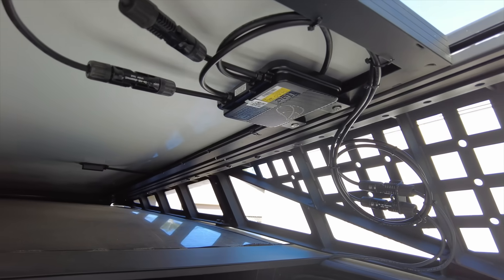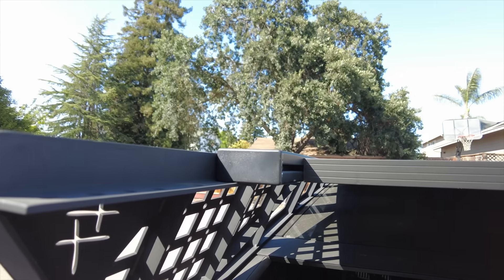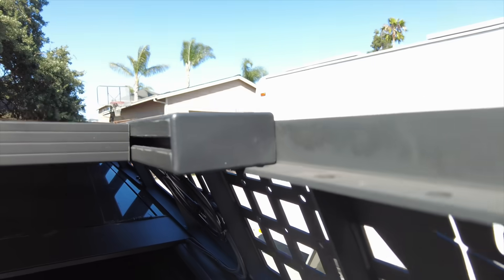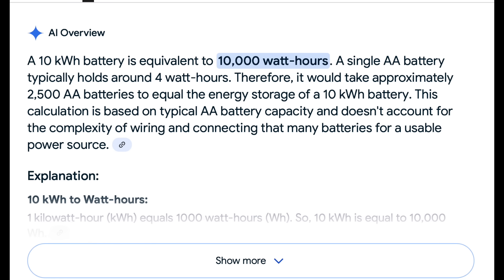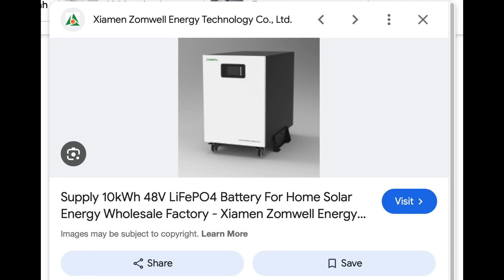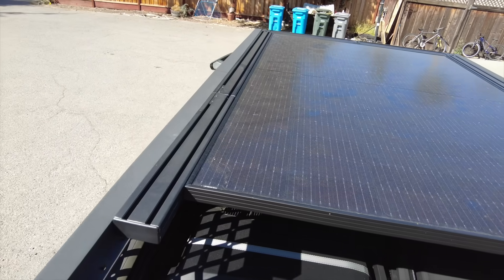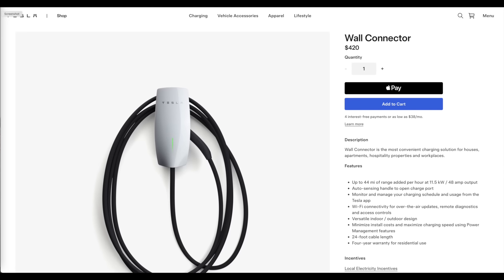Unfortunately it's unknown how much power is still lost to heat the battery during the 30 minutes it takes to transfer. Not only is it not ideal, but now you're monitoring the EcoFlow — when it gets full you dump power at peak down to 0–10%, turn it off, and repeat. It's hard on the lithium iron phosphate batteries and you're tethered to the truck constantly. You can remedy this slightly by buying a larger battery, but that gets bulky and expensive fast. I'm hoping this is just a software issue Tesla can fix with an update.